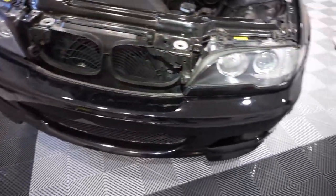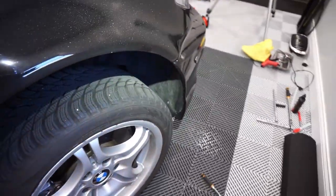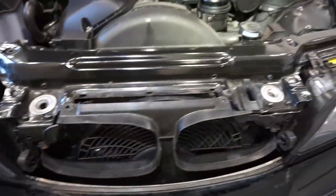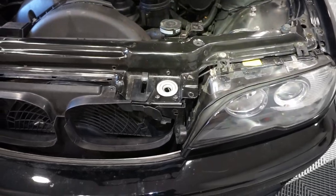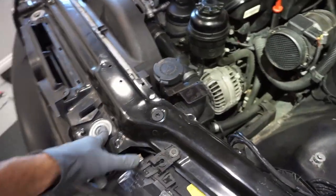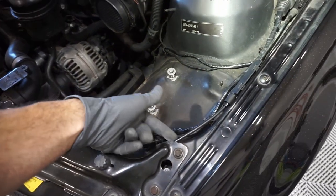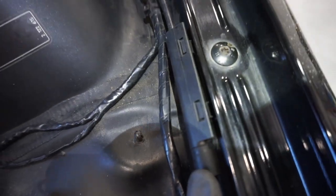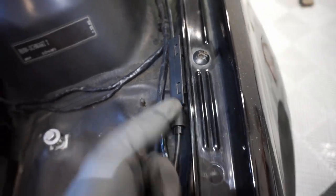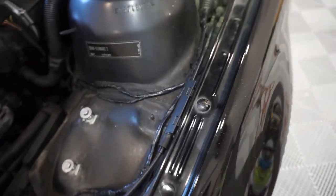Alright, so everything's pretty much back together now. I was just putting the wheel well liners in. That was pretty much the last touch to tie the whole bumper together. What the next steps are, just start buttoning everything up. So like I said, this and this have now been routed through the latches. This main latch, primary latch, is now routed all under here, and then eventually it comes out. There are two little cantilever clips here that snap into the body. Make sure this door is closed, otherwise you are prone to those ears popping out, so make sure that's closed.